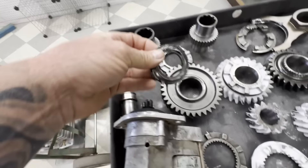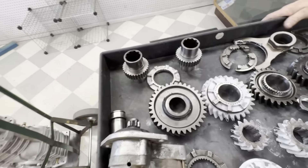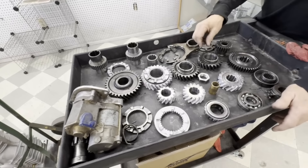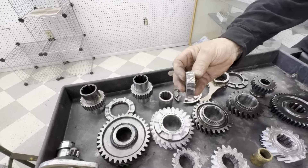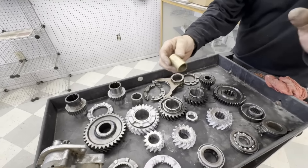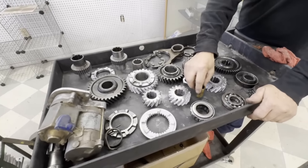Garrett, I think this was you guys with the tracks - I'm going to blame Dave Sparks for that one. Because all the gears got a different width we had to change the spacers between them. Whoever was in there before us had used a chisel rather than the correct socket for the nut on the end of the pinion. The early brass bushing for the throwout fork - those things galled all the time - so we put an oilite bronze one in.